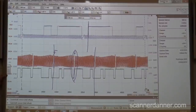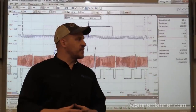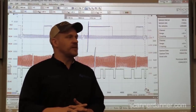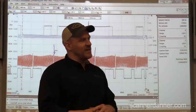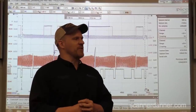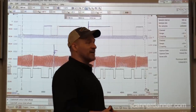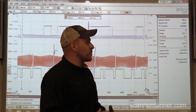So it looks to me like the timing belt is off on this. We wouldn't want to sell the customer a computer with the timing belt being off. Compression would also need to be verified on this motor. Here's what I think happened: the timing belt was put on incorrectly, the computer doesn't know what to do with these signals, and it wouldn't start. In the process of testing everything, he did something and cooked his computer ground circuit. That's how we can explain that the car ran before the timing belt broke and now we have a faulty computer. This would be operator error - mechanic error.